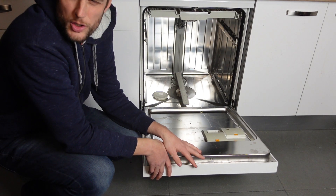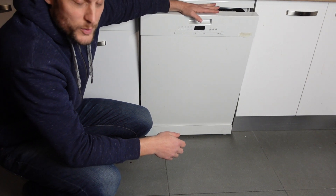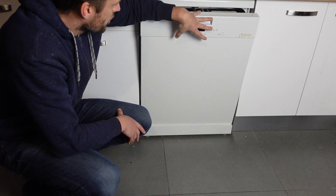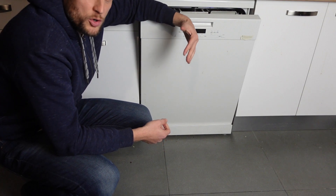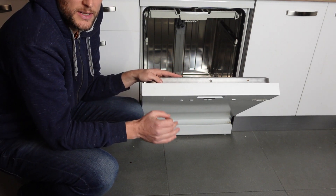The main thing that you can do to get rid of this is to do a hard reset on your machine. You want to reset the power — you're going to turn it off, but not just turn it off, you're going to cut power to it completely. You need to unplug it from the wall or turn it off at the circuit breaker and leave it disconnected from power for at least 30 seconds.